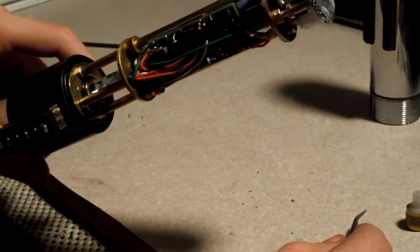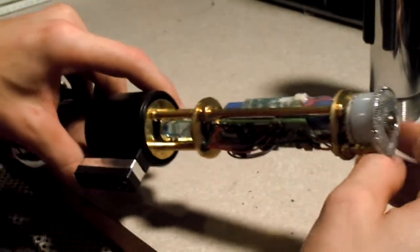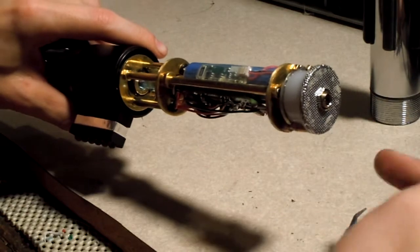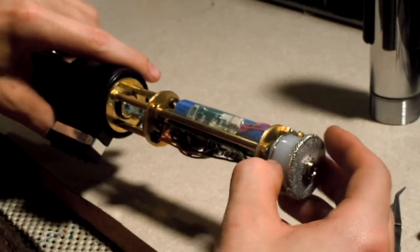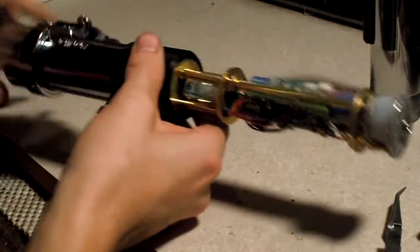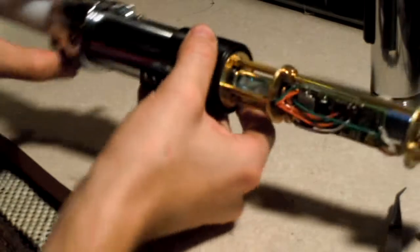So, once you have your card back in, you can put the kill key in, unplug it, make sure it works. Obi-Wan's gonna kill me. Technically you could leave the kill plug in and it's better, but for this purpose I just wanted to show you what it was like without it. Make sure your idle LED is blinking. You can see it is, so that's good.